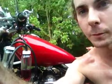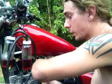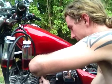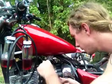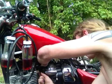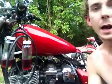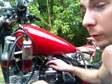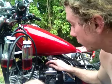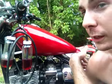There's one vacuum nipple on each intake. I'm going to go ahead — I synced these just the other day, so I'm just going to show you how to do it. You're going to pop these caps off. I don't have a vacuum petcock, so I just have to take off the nipples. When you have a vacuum petcock, it's usually on number two, and you're going to put that on number three or four — just an open vacuum nipple. It just has to get vacuum to get gas to it.